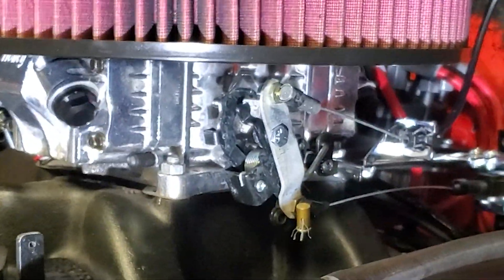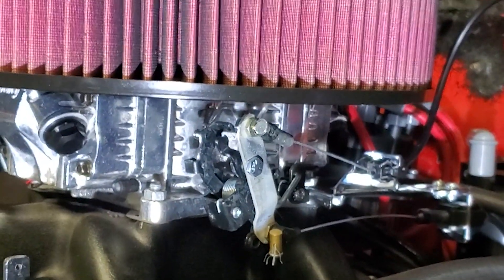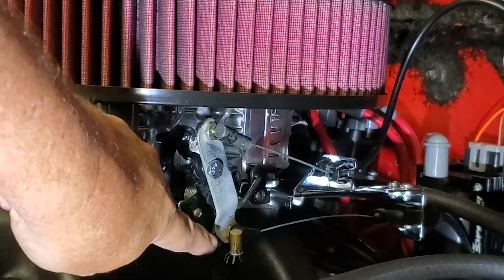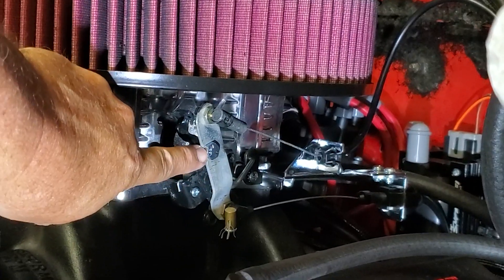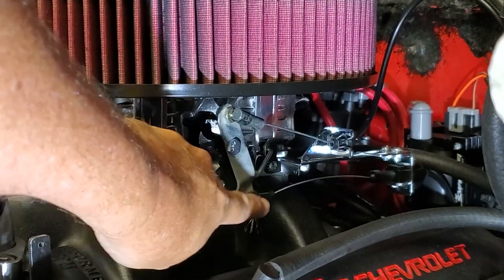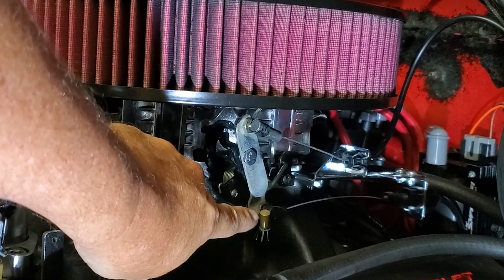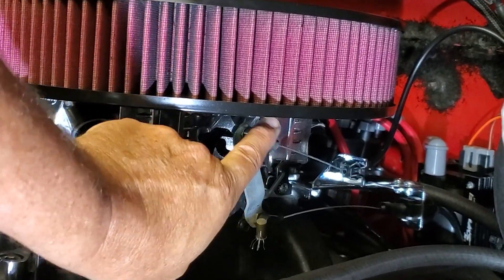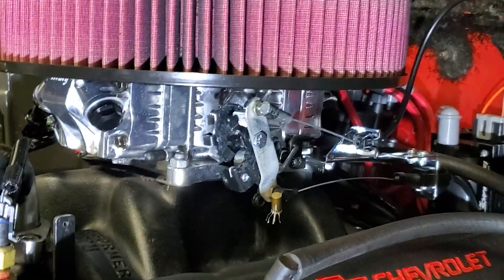This little hack works perfect. Holley makes a little piece like this — I'll have a part number in the description. All I did was take a little piece of metal. Originally my throttle cable would have come into the location where the bolt is. I moved it up one inch, bolted in where my transmission kickdown shifter is. I had to offset these holes a little bit so the cable was long enough, but it went up an inch — and what a difference when I drive it. It works fantastic.